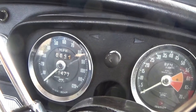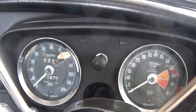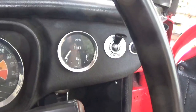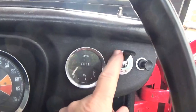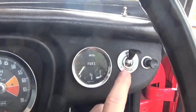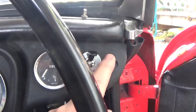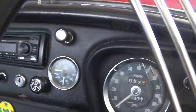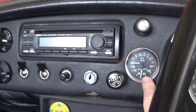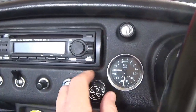The dashboard's fairly standard. We've got our speedometer on the left there in miles an hour, so it's interesting when you're driving around in a country that works in kilometres per hour, but you get used to that. And over on the right we've got a tacho. On the right-hand side we've got a fuel gauge, and the funny-looking switch there is for the electric overdrive — you flick that down when you get to about 40 miles an hour or 70 kilometres an hour and it automatically engages; you'll hear the revs drop when you kick that in. And this is the switch I fitted for the thermo fan. The radio has been replaced — that's a non-standard radio. And over here we've got the oil pressure and temperature combination gauge. That's a manual choke — you pull it out and twist it to lock it on; that's for starting the vehicle.